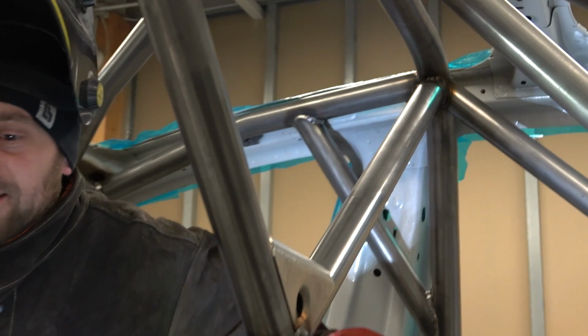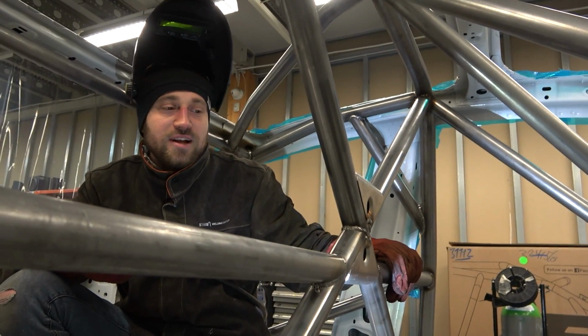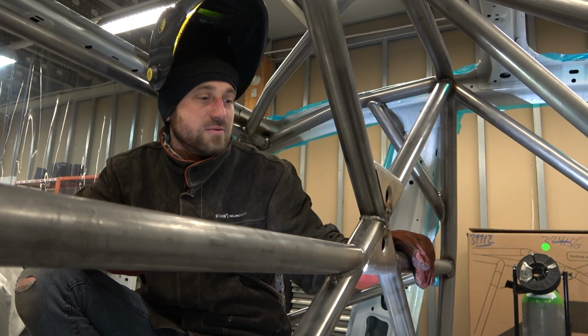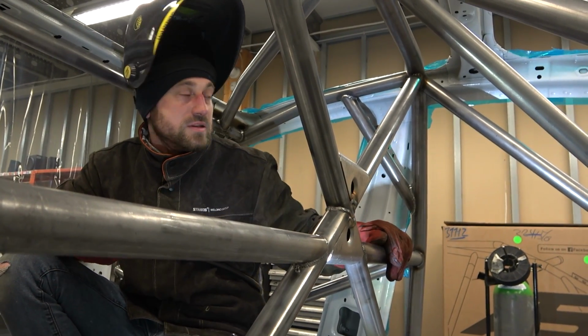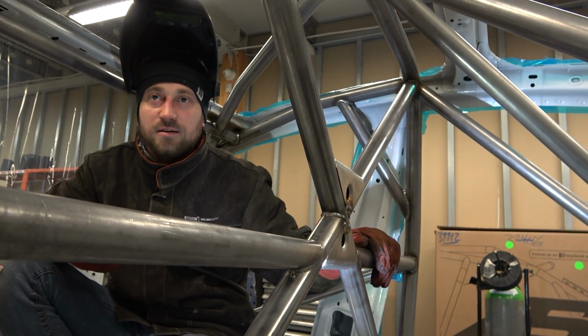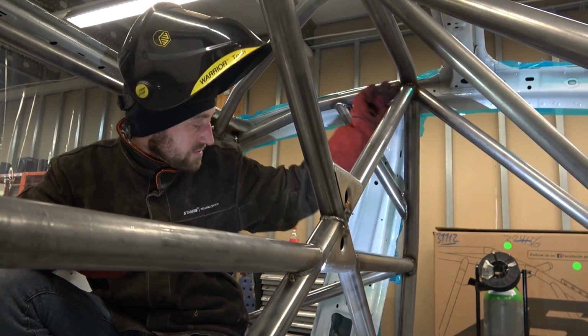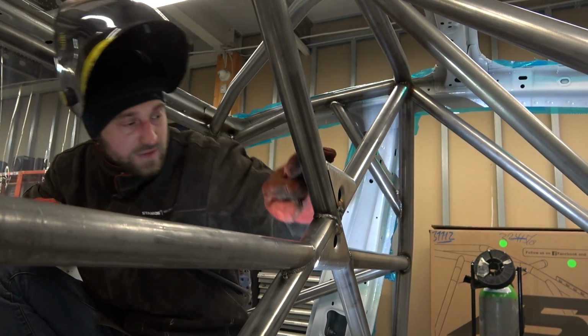Linus, I think the corner is not welded. Good, because it needs to be not welded. When you weld the butterflies, the gas needs to escape somewhere. If it's fully welded, the gas escapes through the weld and the weld is ugly. So here is not welded, here and here. Here is fully welded because the pipe is the same.